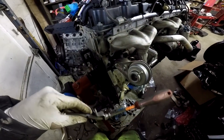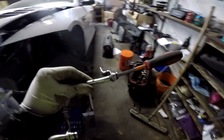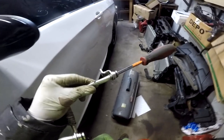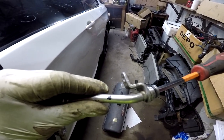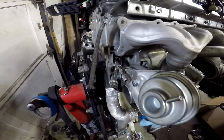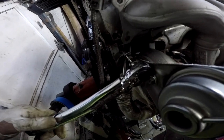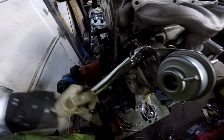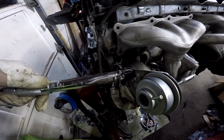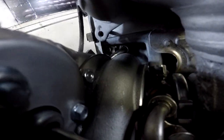Regarding the clearance issue — I confirmed with MMP Engineering and this is a known issue. They have an installation guide on their website, and one of the techs told me they stuck a screwdriver inside and bent it slightly — the same angle I was thinking. I bent the line, shaved off the block, and now I'm using the torque wrench to get it to 9 Newton meters. The line is flush and it's not moving.